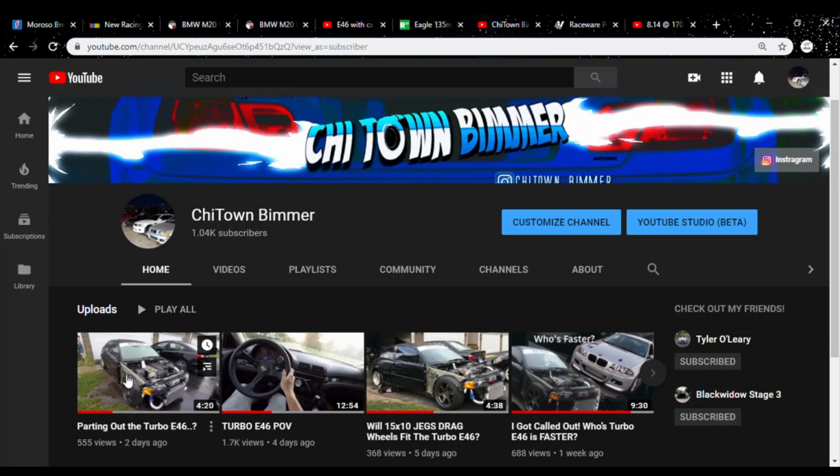Not necessarily bad in general, but because I had a stock piston ring gap and I had 93 in the car, it was running really hot, and at the same time I probably was running 15, 16, maybe even 17 pounds boost, which is a lot for this engine on 93. These engines don't take much boost on the GT3582, which is the turbo I was running, to make good power. I know on similar sized turbos, it only takes about 20 psi to be in that 600 range, definitely above 500. So it doesn't take much. I know people have made around 500 with 15 pounds boost on E85, bone stock, piston, ring gap, and stuff like that. But I'm not gonna blame the engine whatsoever.